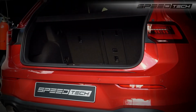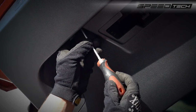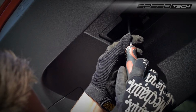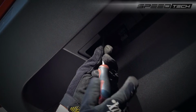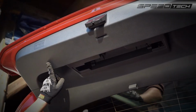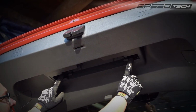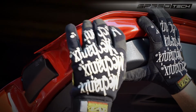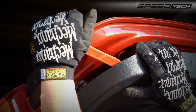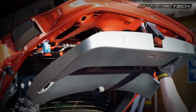After removing the wiper arm, continue the installation on the inside of the liftgate. To remove cover panels and trim pieces, look for screw connections and loosen them. Depending on your vehicle, these can be attached in different places. Be sure to consult your owner's manual. Use a plastic wedge to gently pry away any fastening clips and remove the cover panels.